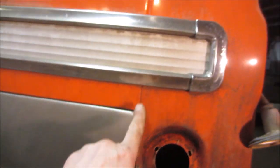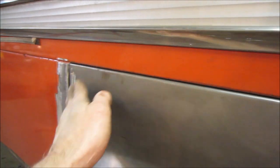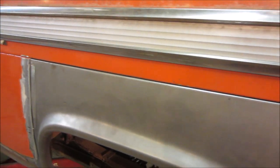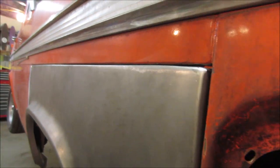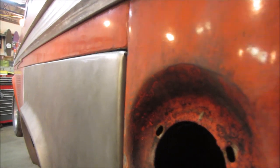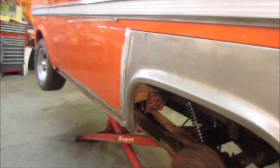No, it doesn't seem that much, but you're trying to mimic the factory seams. The factory seams here. You go from that all of a sudden to a big casual roll to it. I think when we squeeze that one together, plug weld it, put a little seam sealer down, I think that one we got around the money. Good. What do we want to do next?